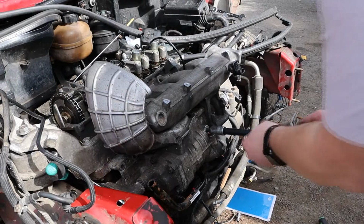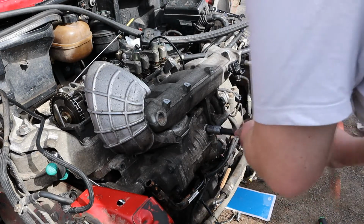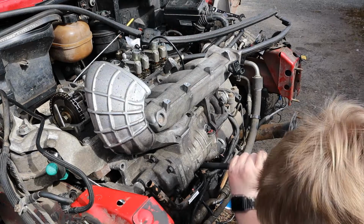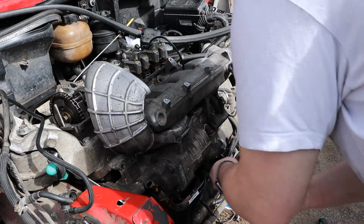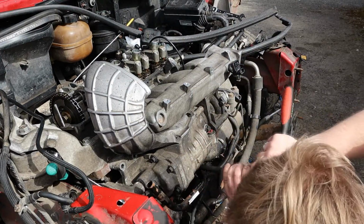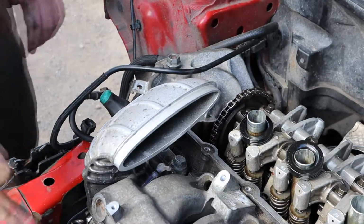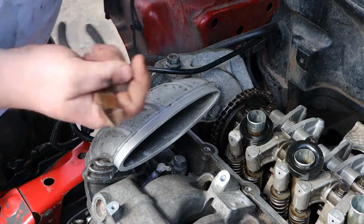Right, supercharger's in place. Spin these bolts back in. So, supercharger and intake manifold are in place, all bolted up, all tight, which is good. So the alternator or drive belt's back on now, using my homemade belt tool: 16mm socket, a breaker bar and jack handle, an Allen key, cable tied or usually electrical taped to a screwdriver, and half a bolt.